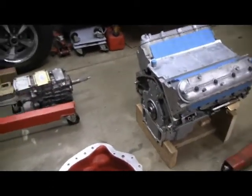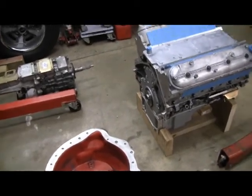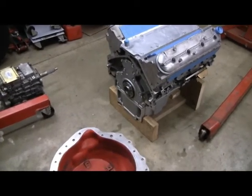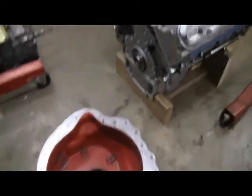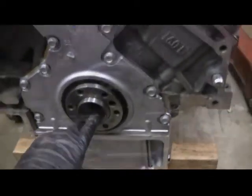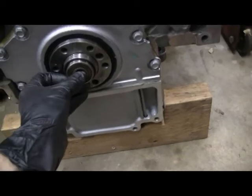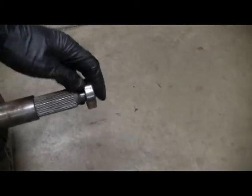What I want to do now is check to make sure I have everything set up to bolt the transmission up to the motor with my bell housing. What's really important is the length of the input shaft versus the bell housing versus where the crank is, because right in here there needs to go a pilot bearing. This is the pilot bearing — it goes in the end of the crank, and then the snout of the input shaft of the trans goes into it.